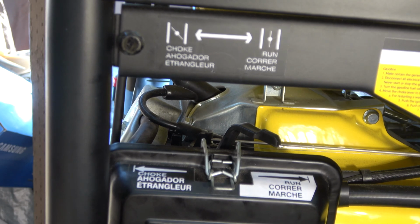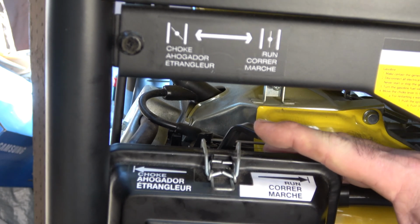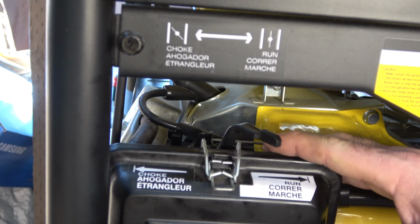Okay, the generator started with a quarter choke at sea level. The propane system wasn't charged until I started the generator. I had the bottle closed, I turned the bottle open, and I started. That was at a quarter turn. The minute it starts, I have to take the choke off. Now I'm going to try to start it.